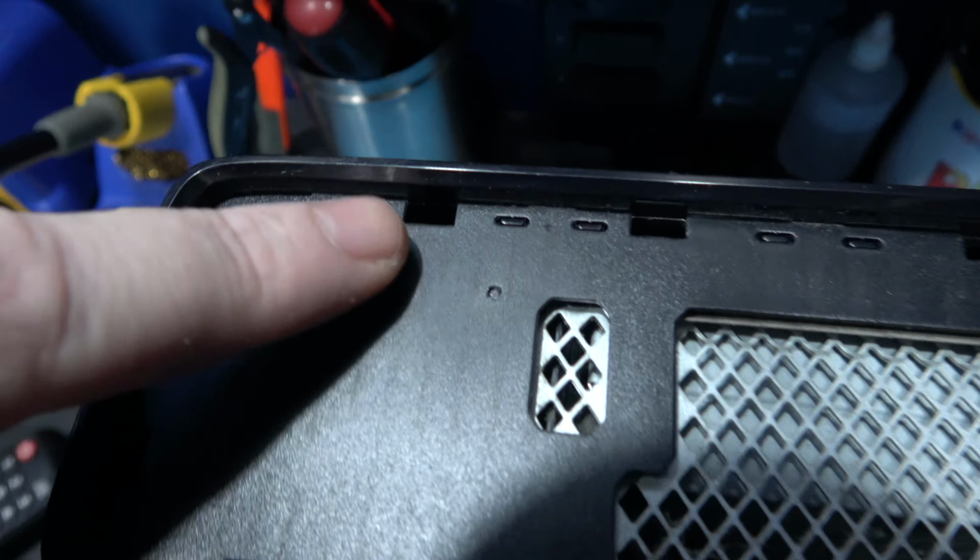We know this is a Corona board, and that will show you where to install the color-coded wires so I can dump the NAND. The JR programmer and the NAND X use the same pinout, so the wire colors are the same. So I'll go ahead and wire those to the board, and then we can see if we can dump this Xbox NAND. That's all the wires wired in for reading the NAND. What I'll do now is get my JR programmer hooked up and run JRunner and see if we can dump the NAND.